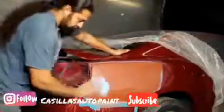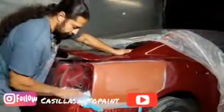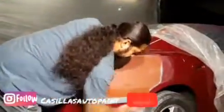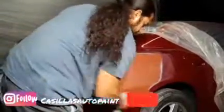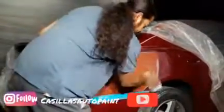and you're going to check right now. What we're going to be doing is checking for pinholes and other tiny little things that we had, because we did use filler, guys. So I like to wipe down the cars, just the general spots. I don't like to have everything super dirty. So just like this. You don't have to wipe it down with no degreaser or nothing, not yet.